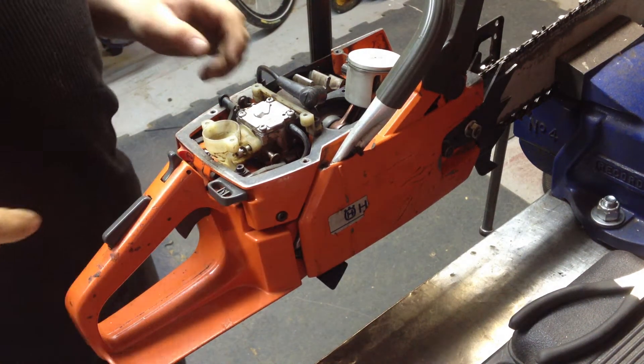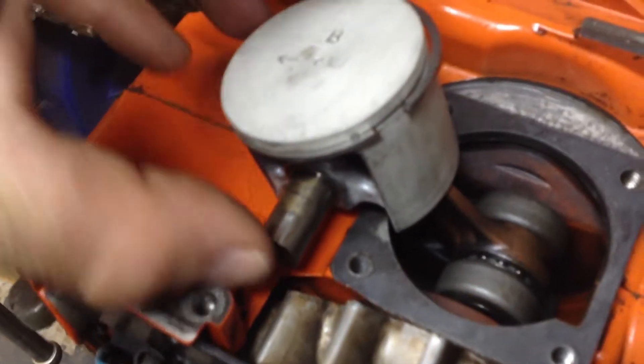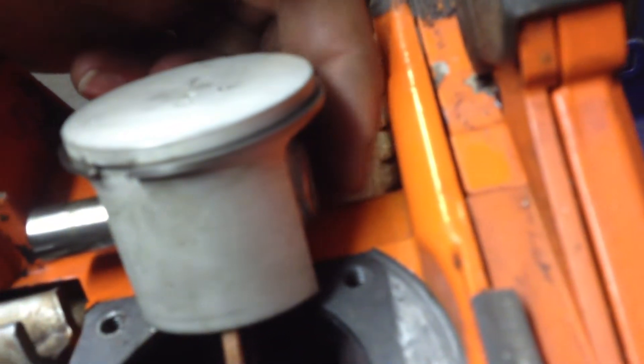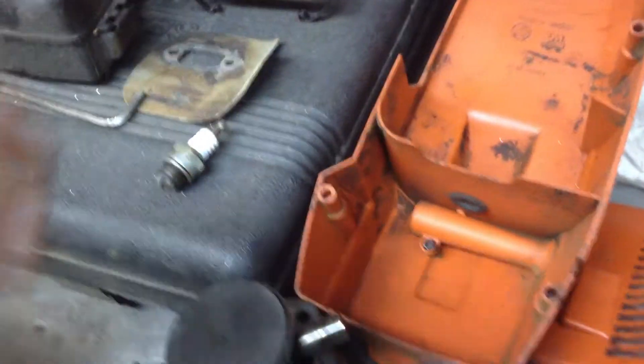I went and took the little piston off, got the new one sort of on there lined up. I've already installed the little clip — you can see that guy there inside. I'm going to very gently try to push this wrist pin down onto this connecting rod with one hand, which is going to be tricky. There it goes — you can see it's in now. Then we're going to take a tool and very gently push that inside like that.